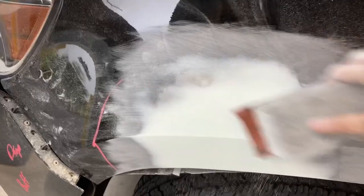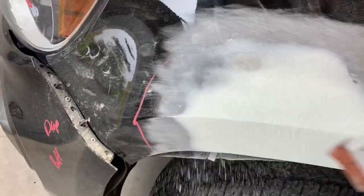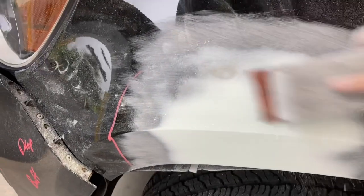You get it down with 180, and what you're looking for is like the top left corner there — where you don't have any hard lines, it kind of just fades away. The edges sort of fade away. If you look at the top right, there's kind of a hard line there, so all your edges need to look like they fade away.